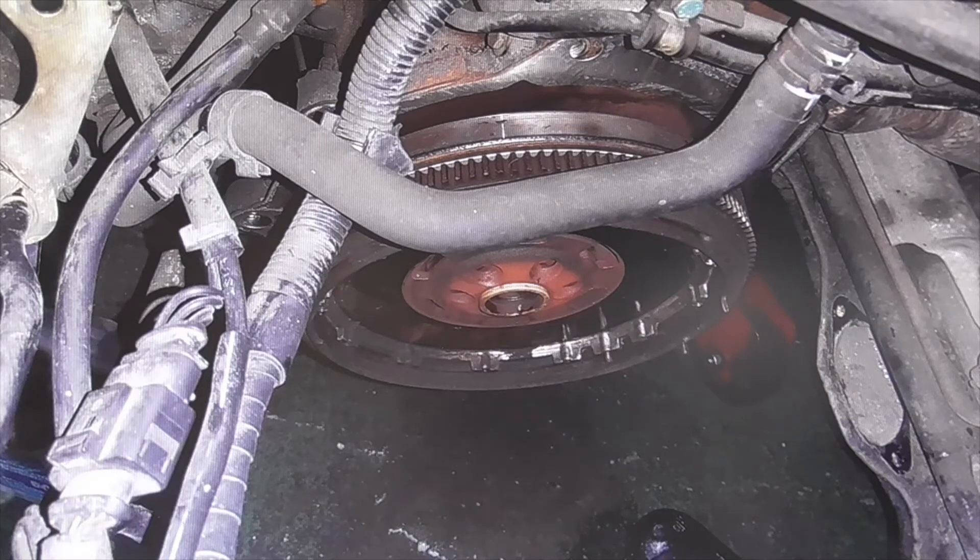The monomass technology has changed a lot — especially the clutch discs, which are now reinforced. They also come with springs of different hardness depending on the vehicle, to absorb engine torque. The dual mass, screwed to the crankshaft, usually absorbs all those vibrations so they do not pass to the gearbox. With the most modern clutches available, with reinforced springs, they absorb part of it — though not all of it, not even half the energy.